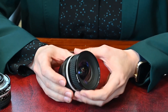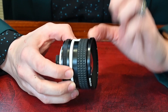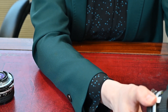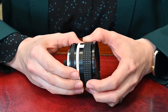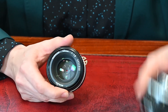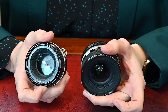Here's one somewhere in the middle. This lens has very clean aperture blades — the aperture is so tiny because it's a wide-angle lens that you probably won't be able to see it — but listen to the sound of the focusing. Focusing should be smooth. If it's a bit dry you'll hear it. I'll hold the lens to the microphone so you can hear. It sounds a little like someone sweeping the floor. What you really want is a nice smooth movement. A loose focus ring isn't the end of the world, but if the focusing ring moves on its own it can be frustrating, particularly when shooting on film.